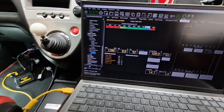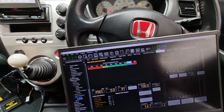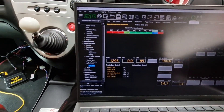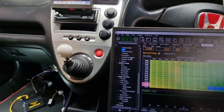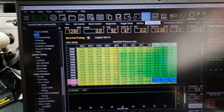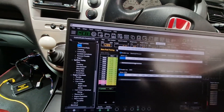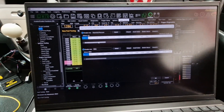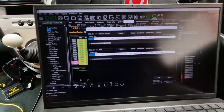We've also got launch control, which is controllable when you're at full throttle. The maps are fully expandable — ignition, main tuning, lambda. At the moment I'm going up to just over atmosphere because this is a naturally aspirated car, but we can easily expand the tables to go up into boost if needed. We're using one of the inputs for the standard MAP sensor, but if you use the onboard 4-bar instead, that's going to save you around 140–150 quid if you boost the car, because the 4-bar is included in the kit — so that's another saving there.